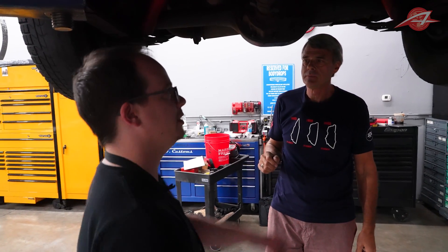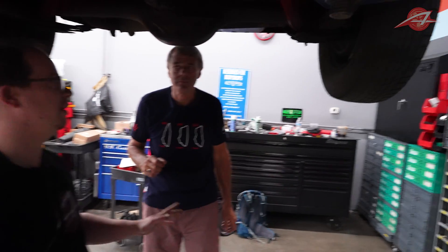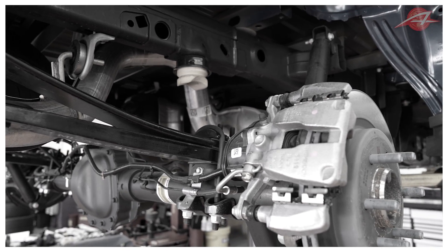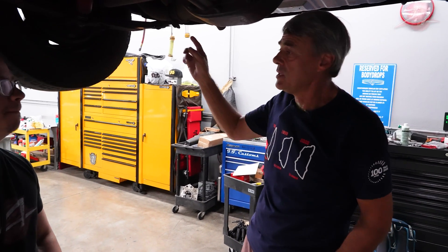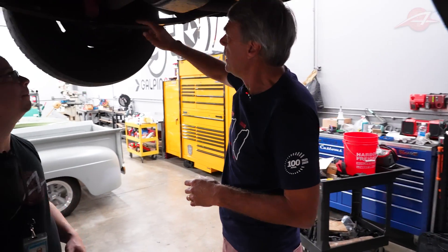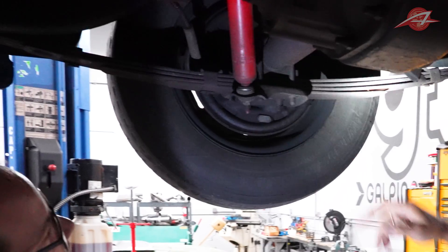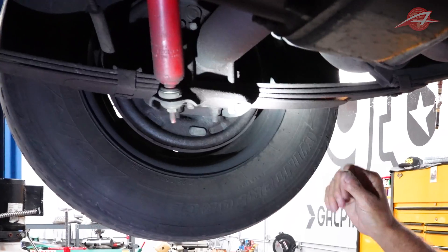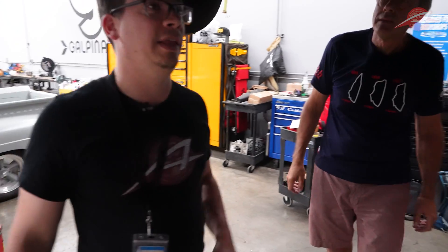I noticed multiple leaves on this — in a previous episode we looked at the F-150 base truck with a single leaf and a helper at the bottom. More modern design for modern materials — the materials to do a single leaf didn't exist back when this was built. Nowadays we have much better materials and also composites to make springs out of. The stack of leaves also allowed you to vary the stack and get different spring rates much more easily.